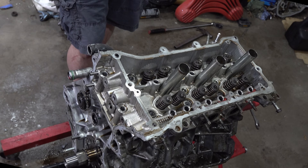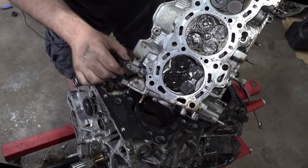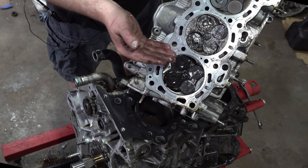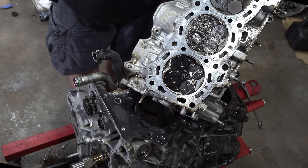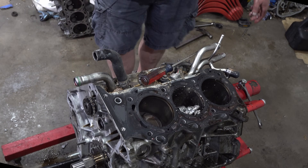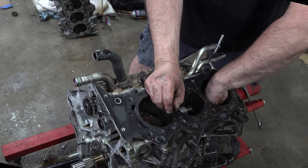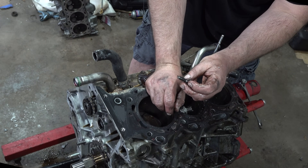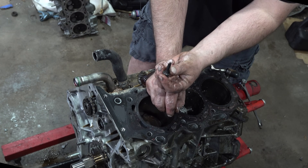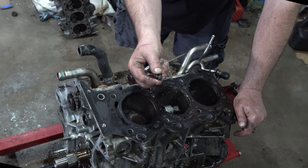And behind bank number two — that's the fun one. I think that used to be a spark plug. There's a piece of ring just embedded right in the head. This head is obviously toast. There's enough left of this to know it's a piston. Well, one of our connecting rod bolts that is missing is snapped off. So now if the other one is completely missing, we still don't know — maybe that was loose. But this lends credence to the fact that it was probably actually tightened properly.